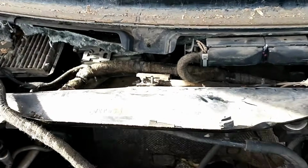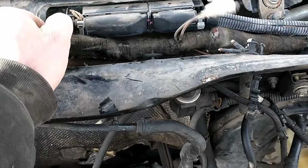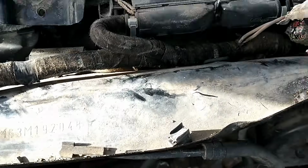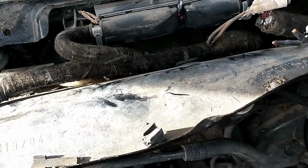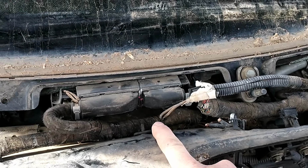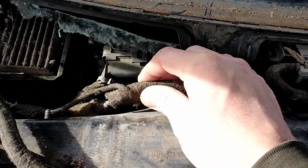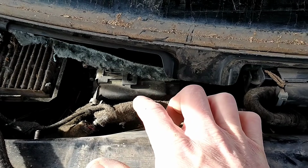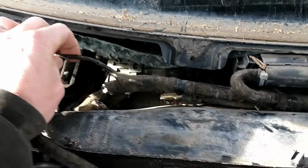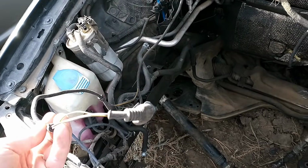transmission controller right here. So just to start with, basically you get this stuff pulled out, and if you can kind of remember from my wiring harness picture there, we're going to cut it. Basically this big harness here, we'll cut it just past the grounds. You don't really need to worry about the grounds, but you can cut it right there. And then you'll cut it again right here where it goes to the trans controller, but you want to leave these wires right here exposed, and those you're going to trace out all the way along here, and it goes behind a bunch of stuff, but this is your MAP sensor.